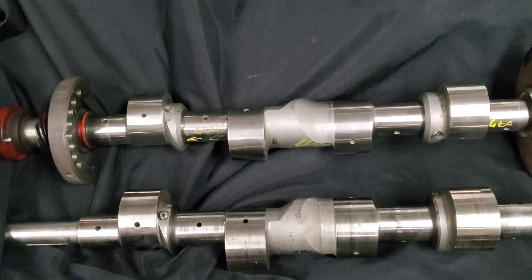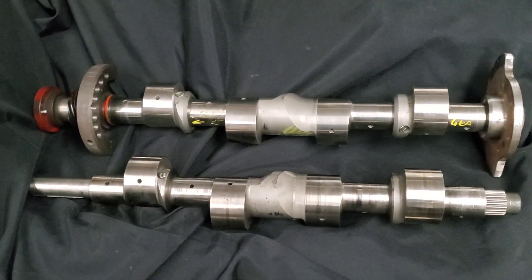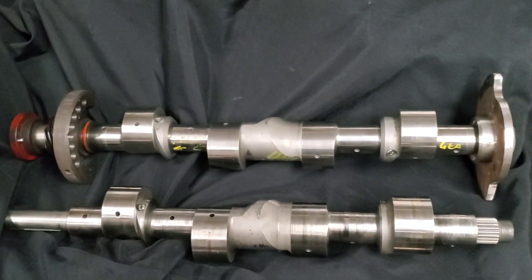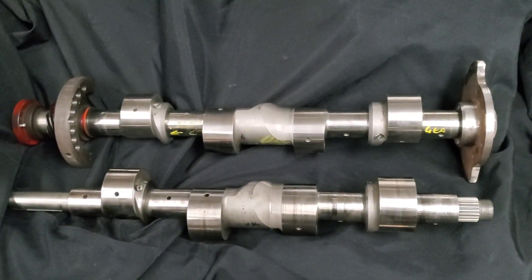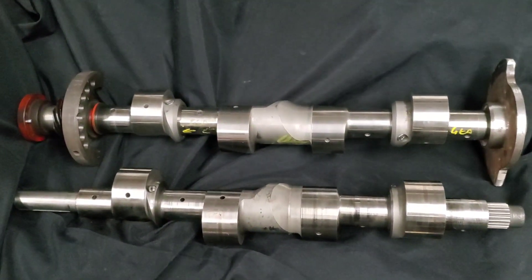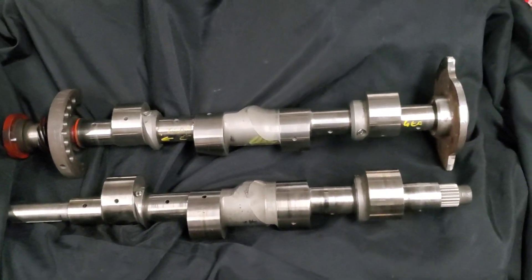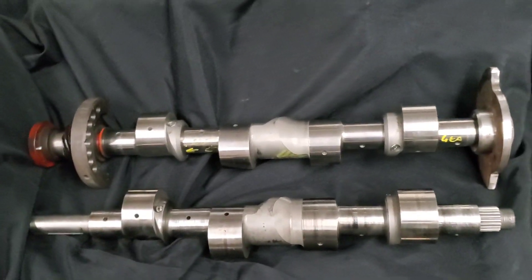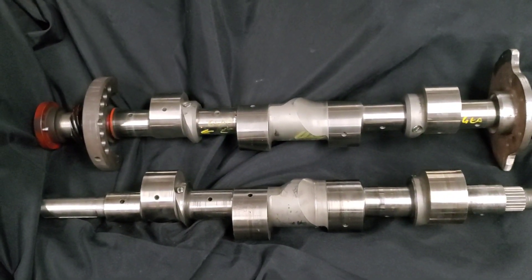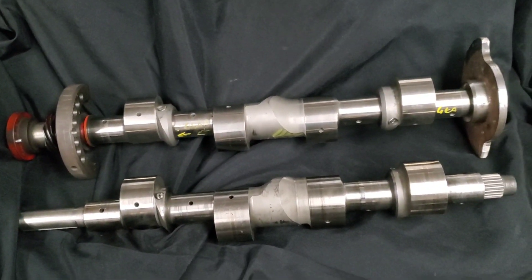I think a lot of people think building a four rotor is like stacking two 13Bs together. I think it's a lot more like getting a custom shaft and building a custom block around it using OEM components — more like building a V10 or V12 LS motor, or a V8 based Hayabusa motor, where you're buying an aftermarket block or kit that utilizes OEM components. That's really what a lot of aftermarket 26Bs and four rotors, whether 13B or 12A based, are doing.